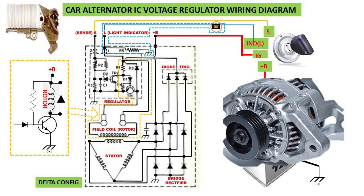What I think is even more critical are the ignition coils. These are all direct-fire — six coils on the V6 Frontier engine, or four on the inline four-cylinder. A higher primary voltage to the coil, which is another transformer, steps up the voltage to around 40,000 volts on the secondary. The higher the primary voltage, the higher the secondary voltage, so a hotter spark ensures fuel is burned completely. This protects the very expensive catalytic converters from being poisoned by unburned fuel making its way through the exhaust system.